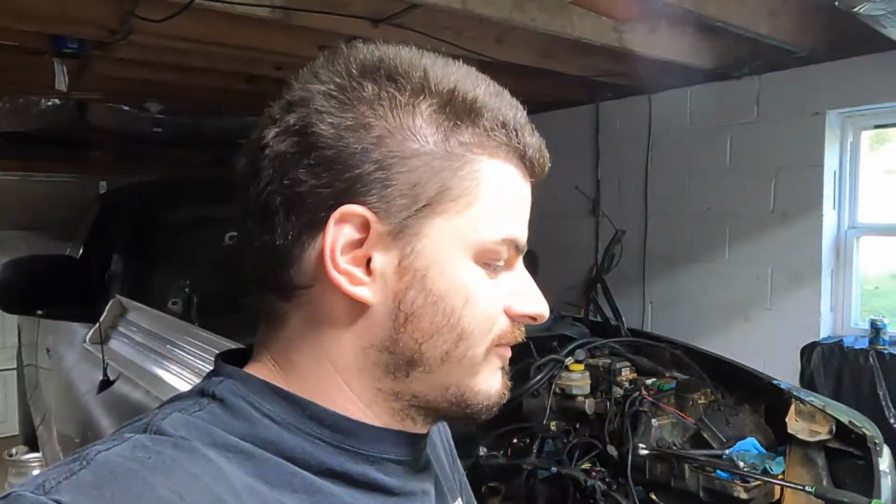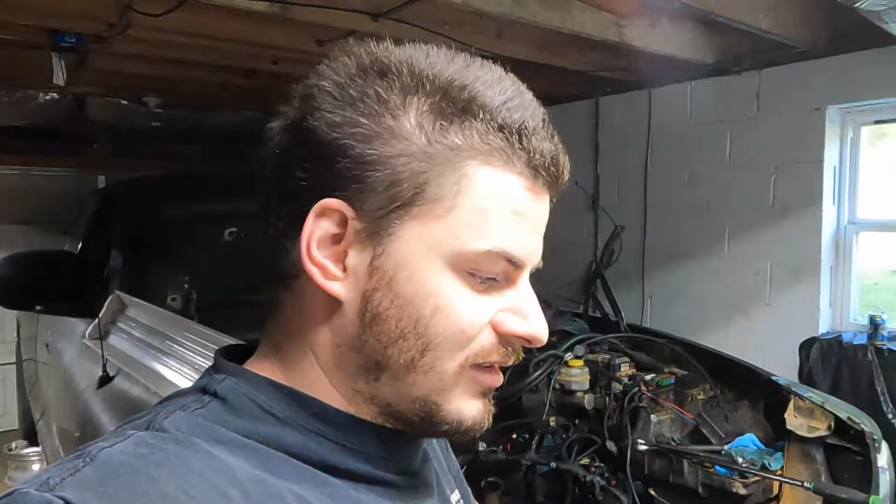I do think I'm going to clean it up here at the house just to get all the crap out of it. I'll put some bearings in, put the crank in, put a couple pistons on some rods, and start checking deck clearance just because I'm curious. And I've still got to work on figuring out the heads, and I'm sure there's a lot of other things I'm forgetting. I still have to order pushrods, lifters, and all the gaskets. I think I actually have a high volume oil pump already. I'm going to go ahead and get a windage tray if I can find one.